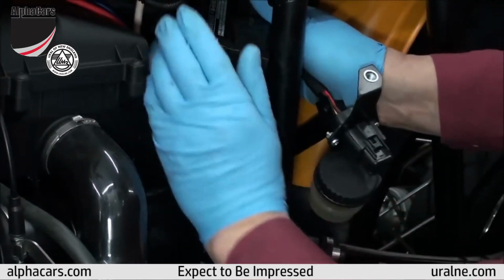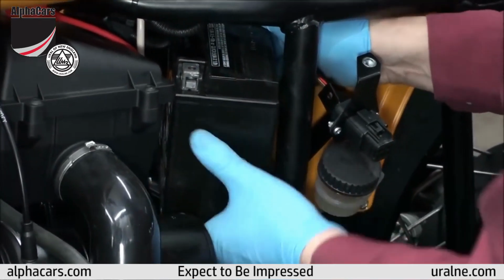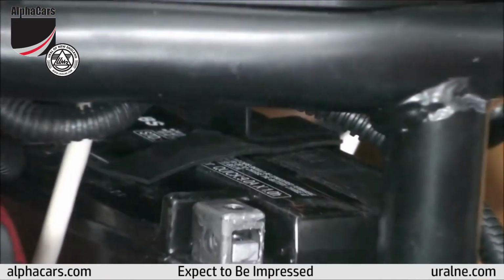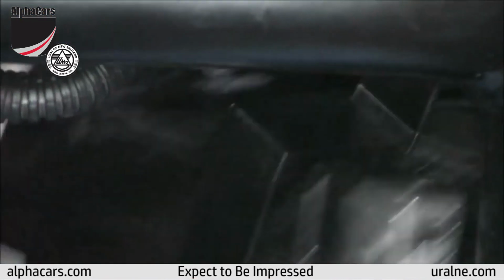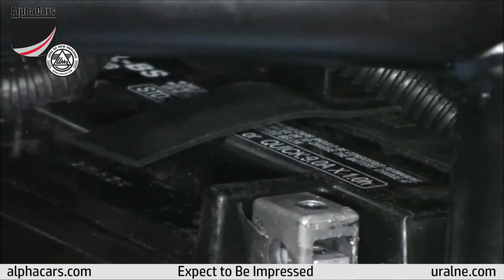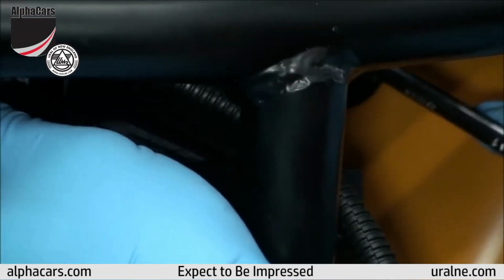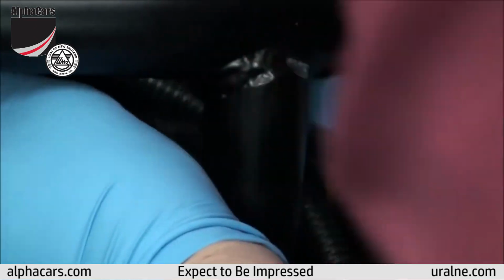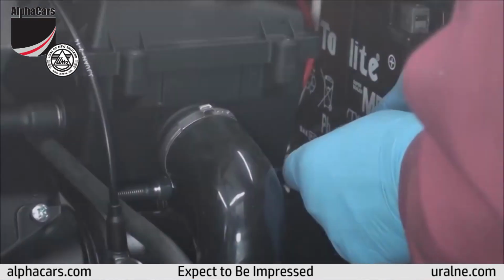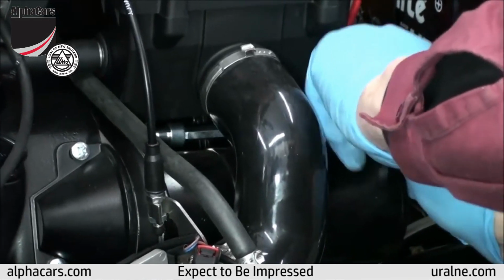So you can see the technician placing the battery back into the bike. It is a delicate procedure only because things are pretty tight there. But as you can see, it is going in. There is a little rubber gasket that is to go between the two battery brackets, half brackets, one for the back side, one for the forward side. And then you connect the hardware and tighten things up by that bracket.